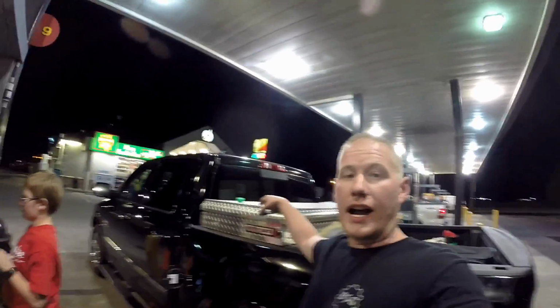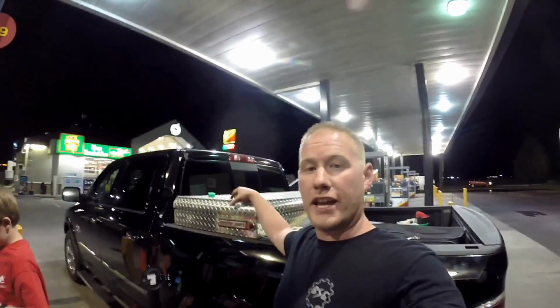So, like I said, it's a very easy fix, but it's definitely a screw-up by the dealer. You're just trying to get the valve cover and the PCV oil separator changed out to the new design that separates the oil better, and they misconnected that on there. So we're going to take care of that real quick, and that should take care of, I'd say, 90% of its problems.